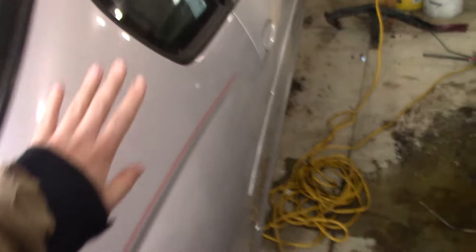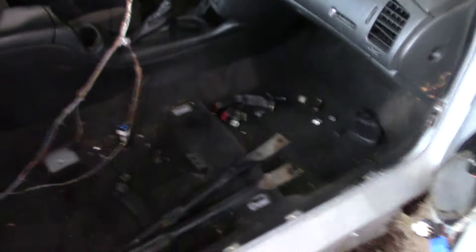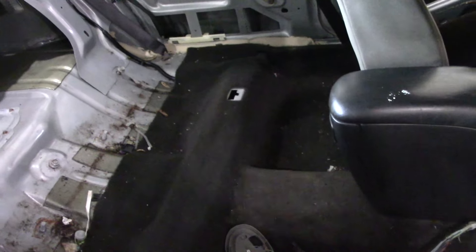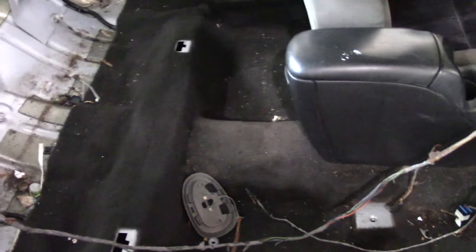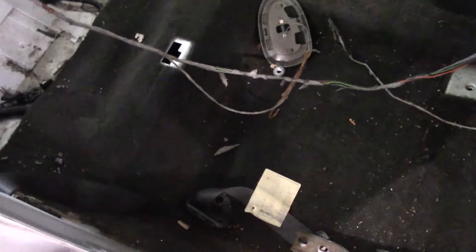We're getting away from the trunk. Let's walk our way to the vehicle — interior. Pretty generic, typical. This door doesn't have to stay open — the hinges are protesting, this thing just shuts itself. We've taken out the interior, seats out, backseats out — kind of as far as I'm going to go with stripping it. Could I take the carpet out? Anytime I stop stripping, it saves me time because I have so much more other work that's more important. I've been leaving the carpet in most of our vehicles — just leave it, throw in the cage, and move on. I usually take water and just splash it all over the carpet the day that I weld the cage in so nothing catches on fire, and it's been perfectly fine.